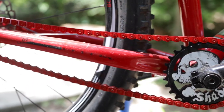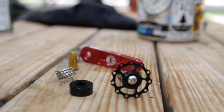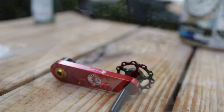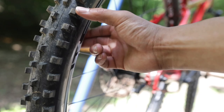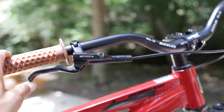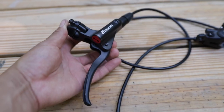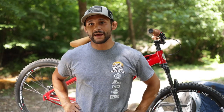So far, we've got a chain that is completely slack. That sucker bounces all over. So we're going to fix that with a chain tensioner that our boy Berserker sent us. Step number two — we are going to change out these tractor tires for some Kenda KRAD tires, 26x2.30 that Berserker Nick sent us. And then we're going to get rid of this terrible Maroka four-piston brake and put a four-piston Zoom brake on the back of this bike. Everybody gets tired of you confusing Magura and Maroka. People are sick of that.